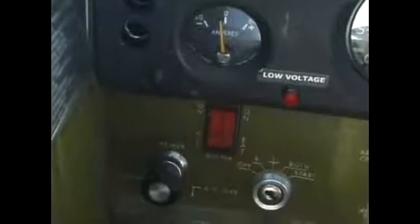The master switch will come on — that's this red switch over on this side — which puts electrical power to the aircraft. Next we're going to prime: we take this plunger, pull it out, and what we're doing is atomizing fuel directly into the engine cylinders — into two of the cylinders — which will aid in getting the engine started. Then we close it, lock it, and give it a tug to make sure it is locked.